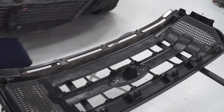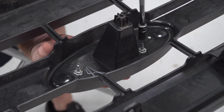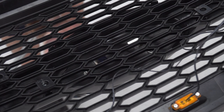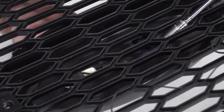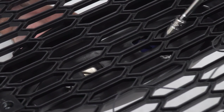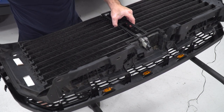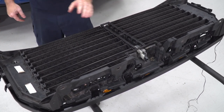You can now remove your active shutter assembly from the back of the grille. Still using your 10-millimeter socket, remove the 10-millimeter nuts securing the Ford logo to the back of the grille. Transfer your logo to your new grille and tighten it down using your 10-millimeter socket and the factory hardware. Then take your active shutter assembly, lay it in place on the new grille, line up the four corner studs, and set it down.